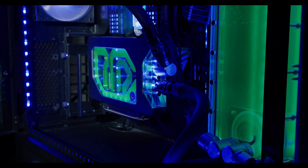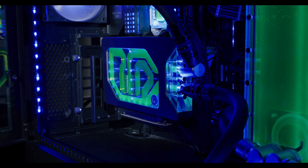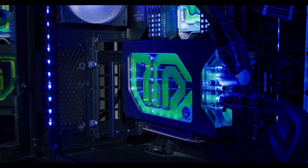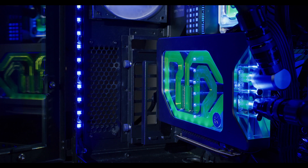As we get to the 3090, things are a little bit dicey. NVIDIA's recommendation is a 750 watt power supply. Not only does the rating matter, but you want something at least gold — preferably platinum or titanium — and it has to be a well-made power supply. With the 3090 and 6900 XT, the same thing holds true as with the 3080. Some overclocked models like the EVGA FTW3 will hit 500 watts — don't try that on this supply. Even with a 3080 or 3090, that's going to be way too much power; you really need 1000 watts or above for something like that.